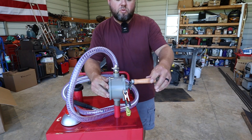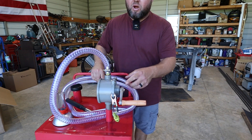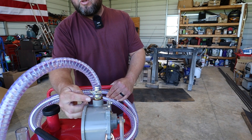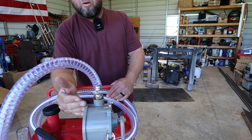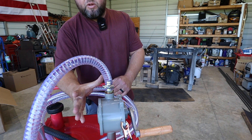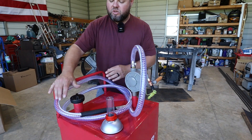The pump feels a little small, a little chintzy — let's just be honest. But if it pumps, who cares? It's just a manual hand pump. I'm not going to run it around too much until we get it lubed up. They provided what looks almost like a Loctite — a red liquid sealant. I use that because you don't want to wrap connections in Teflon tape due to the fact that standard tape isn't rated for fuel. So I used what they supplied. Hopefully no leaks; if there are, we'll get some fuel-safe Teflon-type tape.